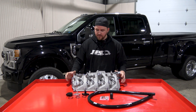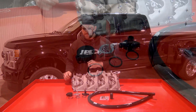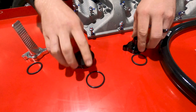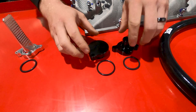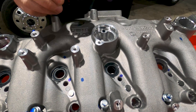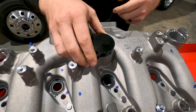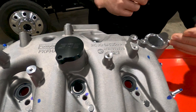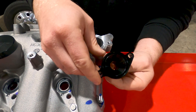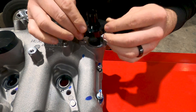We'll go over all the parts on the bench and how we offer these kits. The main pieces to the basic CCV kit are right here. This is the oil block-off plug — it's the drain back for the box, and obviously you won't have that anymore. It's an O-ringed plug that drops right in. Then you have the port for the crankcase pressure to come out of the engine, and we have a Venturi-style adapter that goes to three-quarter inch hose.